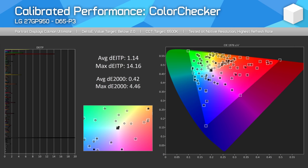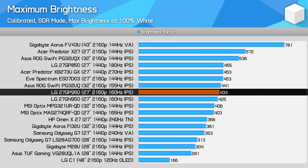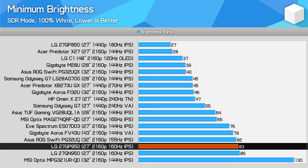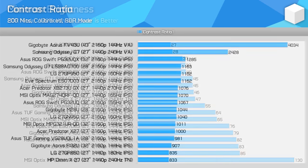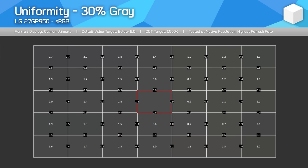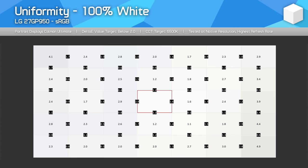The 27GP950 has good maximum brightness — though fundamentally no change over the 27GN950 — still around 430 nits, which is what this panel is capable of. Minimum brightness is also basically the same; unfortunately it doesn't get very dim, and I'd have liked to see below 50 nits for those using this display in dark rooms. The contrast ratio is good for an IPS panel and identical to the EVE Spectrum 4K. Unlike 1440p nano IPS monitors with terrible contrast, the 4K panels have always been at or above 1000:1, and results here are actually above average for an IPS. However, it still gets smashed by VA monitors like the Odyssey G7, which have much deeper blacks. Uniformity was very good, with no major brightness deviations across the panel and only a very slight colour tone difference from left to right — only an eagle eye viewer would notice.